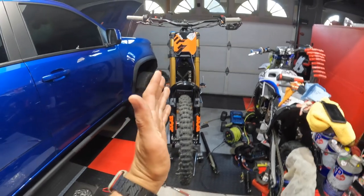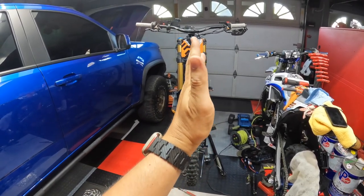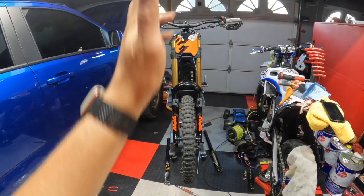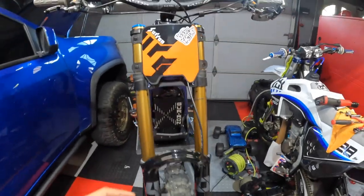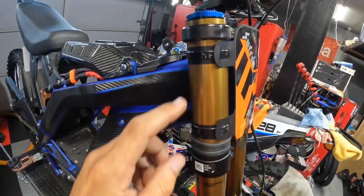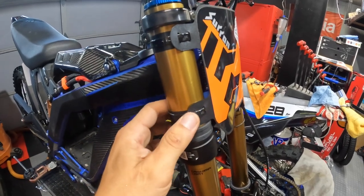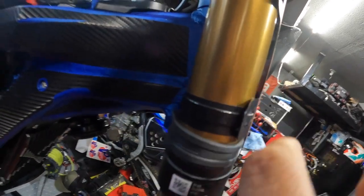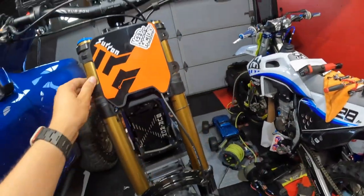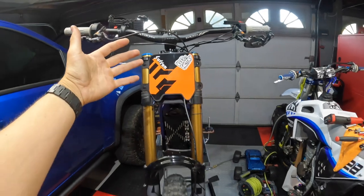She's just about all buttoned up. Just by looking at it, when I get her on the ground I'm gonna have to tweak the bars a little because it doesn't look like it's aligning right with the handlebar, so I'll loosen those up and tweak it. Got the plate on. I added a little piece of electrical tape where the zip ties were going to sit, and moved the bump stops all the way down so that as this moves up and down it won't wear into the Kashima coating finish. It really only looks like it's just one spot at the top touching, so that should keep the coating protected.